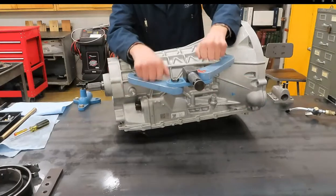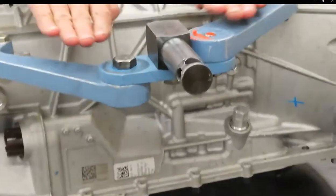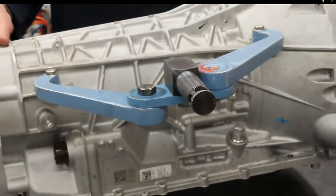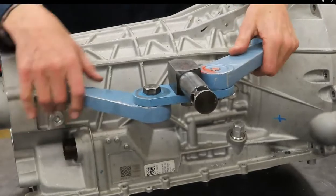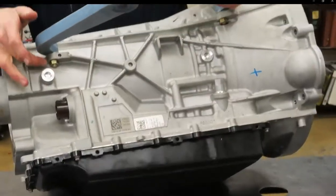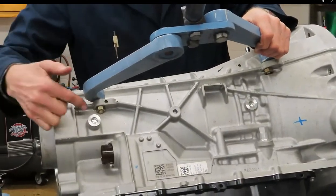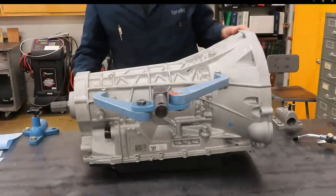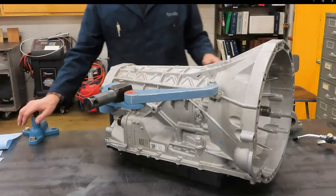It staggered this transmission mount. I'm going to have them both in the same plane — they're staggered, and that's to fit these bosses from the factory in the case. I had to modify one nut that sits kind of close to the case right here — I had to actually grind one of the six sides to make it fit in there a little bit easier. But other than that, it's just 8mm bolts holding this on, which sits in this clamping device here.